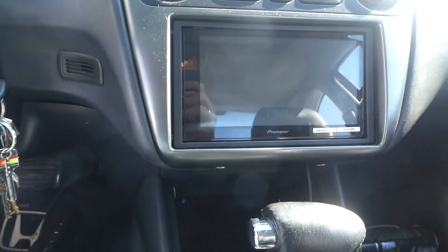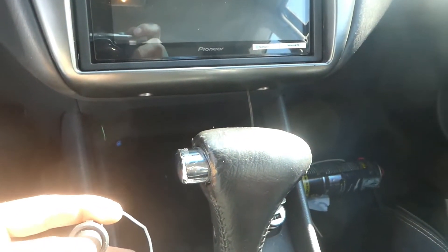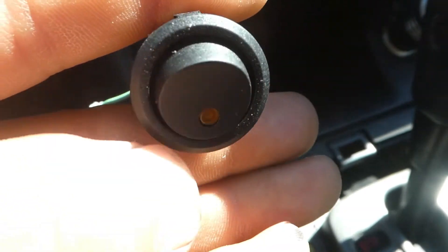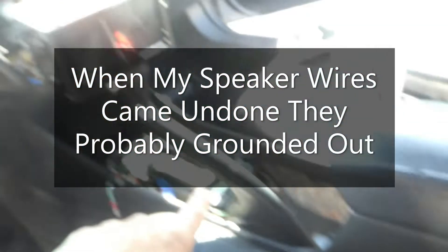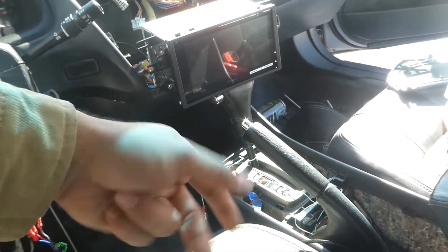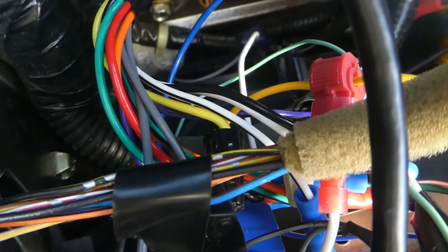My radio didn't even turn on. Alright guys, if you run into the same situation after you put your radio together — check your radio fuse on the passenger side. I'm pretty sure that guy's blown. I accidentally touched my ground while I was doing this so I probably grounded it out and burnt my fuse. If your fuse is good, check the fuse on your radio — my fuse on my radio is good. Then I checked my power cord — my yellow is still good, it's got a good connection. So now I know it's my fuse.